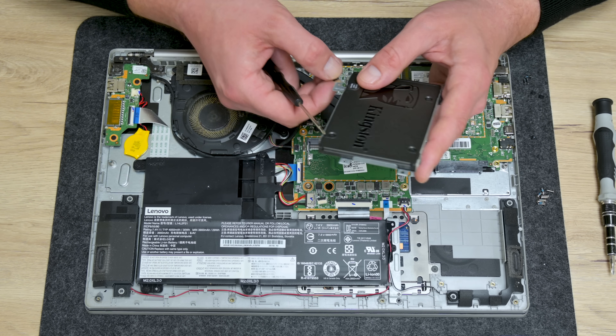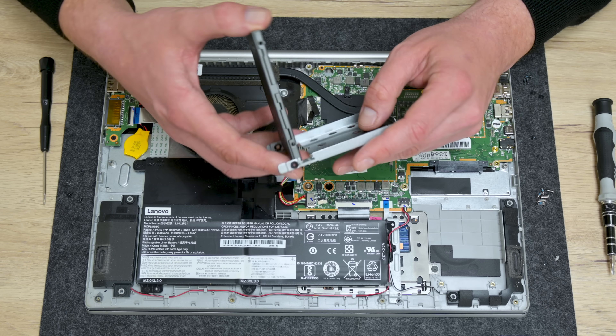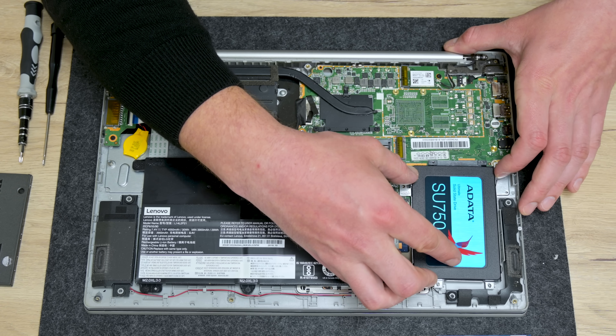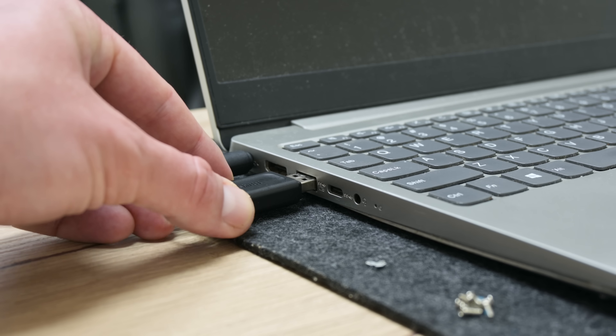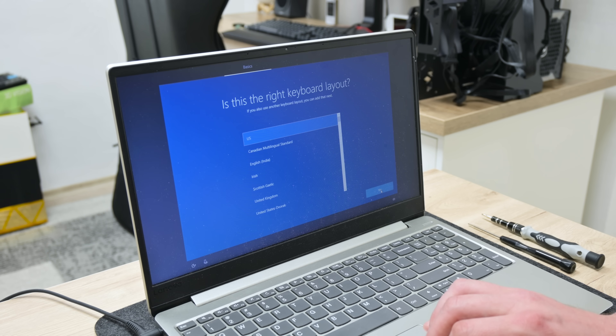In general, this machine is functional, and while testing before, I didn't notice any other problems with the hardware, which is good. I took another new SSD, and fortunately the disc was recognized with no problems at all. So the motherboard is good, and the problem is coming from the SSD.